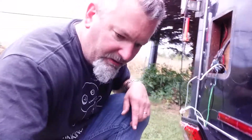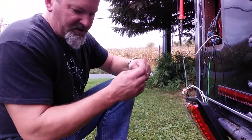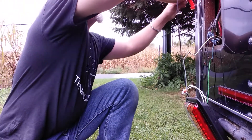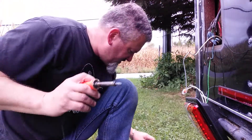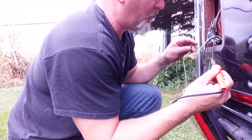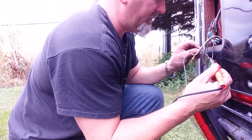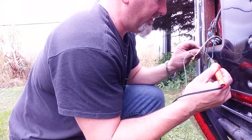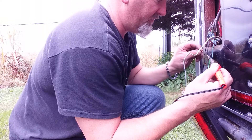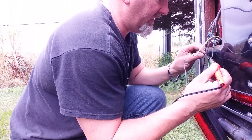Like I said, one black wire goes to the white, which is for your reverse, and the other one is for your stop. So what we're going to do — if my tripod cooperates — we're going to solder these up to finish off the wiring. What you want to do when you solder: a lot of people think you heat up the solder. No. What you want to do is actually heat up the wire, and then you want to get that wire hot. I like to dab a little bit on the iron, and then I'm touching the wire, not the iron.